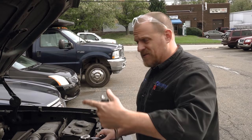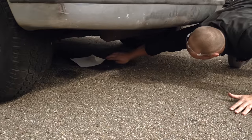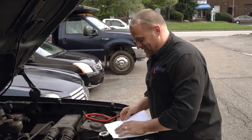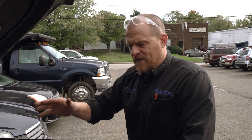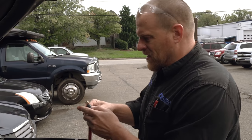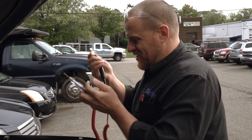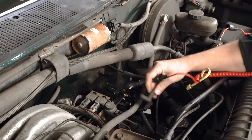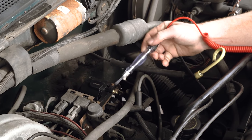I have the key on, which allows me to have spark — it can be really dangerous. There's safety issues involved when you do this. You need to make sure you're in park, parking brake set, and if it's a manual transmission, you might never want to do this remote start cranking. This is going to allow me to let Caleb be cameraman and do the checks I want to do. I'm going to start with just going right to the coil and crank it — have it jump through my test light to ground. No spark whatsoever.